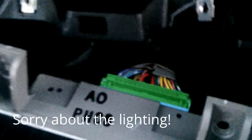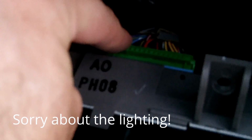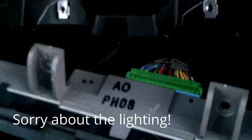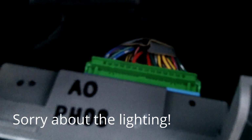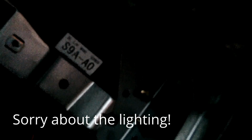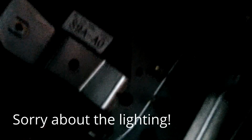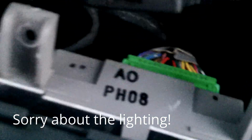And there's a connector on the back, and if you find the same colors, the two control wires coming out of your transistor back here, you can test for continuity at one end of the wire here and at one end down here. You can also test for a short to ground by testing for continuity between that wire and a ground connection like that one back there. So whether you want to go into that detail is up to you.